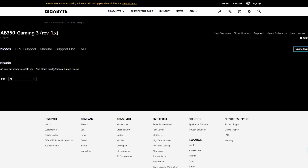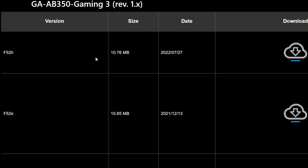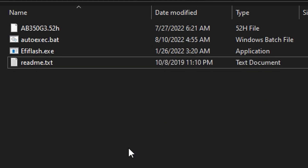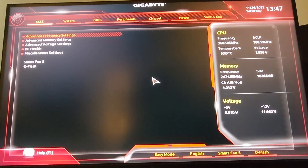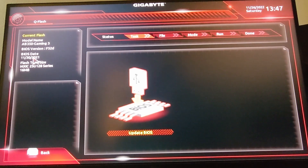What we're going to have to do is go into the support menu here. If we scroll down a bit, we can find the BIOS listed. We see the F52H, which is the version we need in order to upgrade this specific motherboard to the latest version. From there, we can extract it and put it onto a flash drive, which allows us to go right into the BIOS through the flash drive. Opening up QFlash, we can see it detects our current version, which is F52D, and we just select the update BIOS button right here in the middle of the screen.